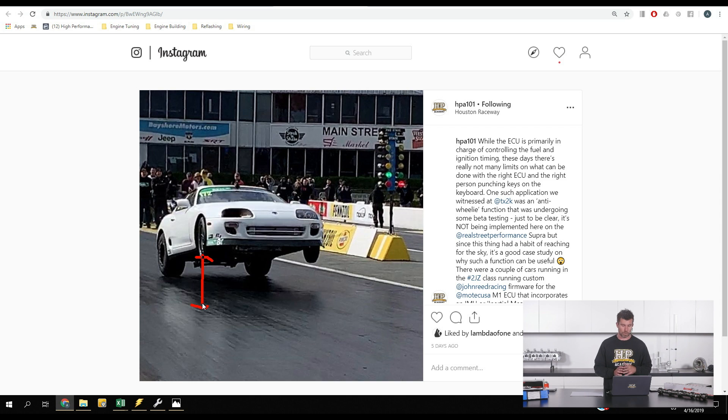This is a pretty big problem with drag racing in general. In a lot of classes, cars are fitted with wheelie bars — makes sense, stops you getting into this sort of situation. A second or so after this photo was taken, the driver decided it was a pretty good idea to back out of the throttle. When that happens it's a really delicate balancing act; generally the driver can't ease off the throttle gently enough to just bring the front wheels down. In severe instances, the front end can come down so heavily it damages the chassis, engine, and suspension. And in some classes, wheelie bars are illegal.